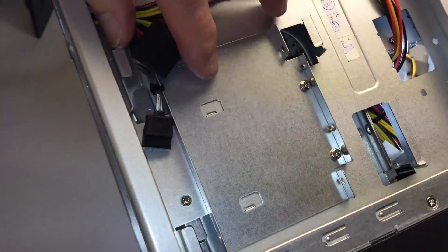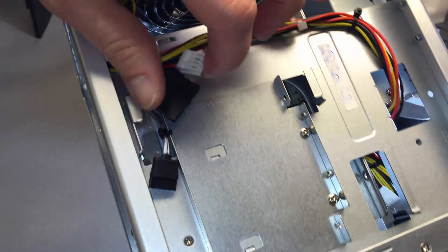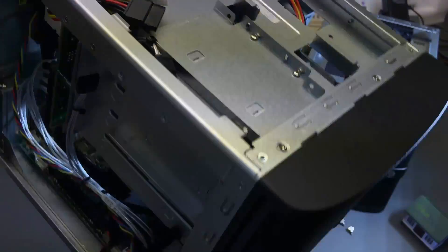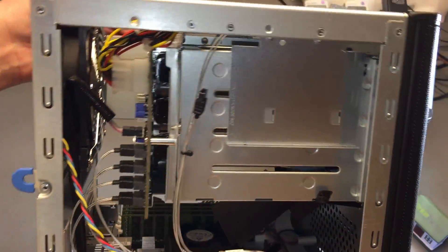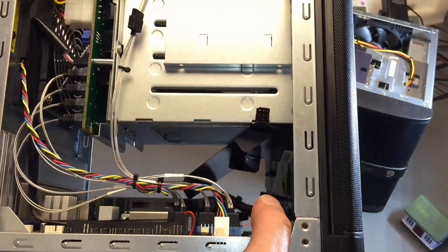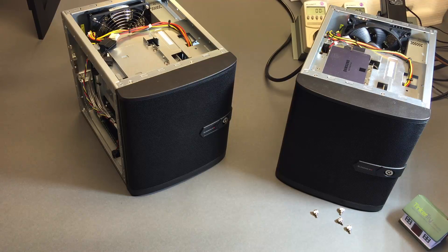I like what they've done with the routing — you're ready to go. Supermicro does something a little weird at the top: to actually install a drive there, you'll need to snip off the wire tie and give yourself some slack. It's weird they tie it off to the side — really just for shipping. All WiredZone really needs to do physically was add the speaker and the 6-SATA cable, put in the DIMMs, and fire it up for a test. So there you have it — first look: unboxing the Supermicro SuperServer 5028D-TN4T with a Xeon D1541 CPU. Thank you for watching — hopefully you found this helpful. Thank you for visiting Tinkertry.com.